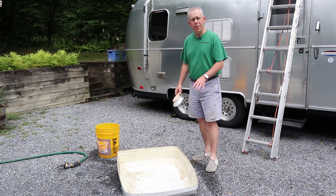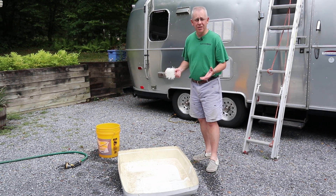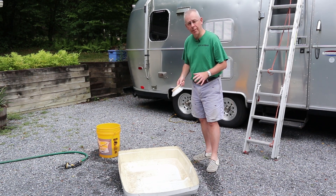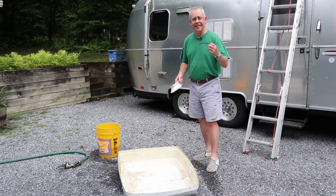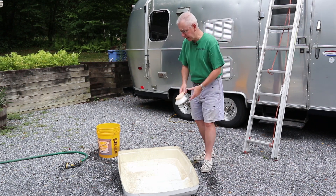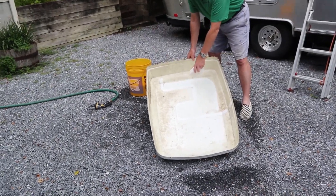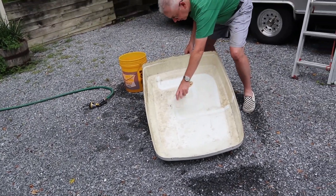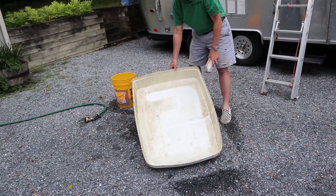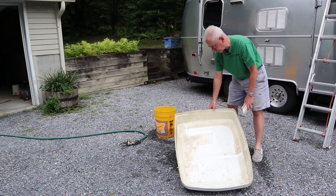We're going to go ahead and clean the cover. Remember, the reason you clean things during maintenance isn't just to make things look pretty — it's also to detect anything abnormal. You're looking for cracks, leaks, things like that. That's why you keep a clean engine. You can see the pattern here showing where the coils sit right along this area, so you want to make sure that area remains clean and there's nothing unusual.